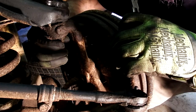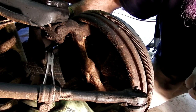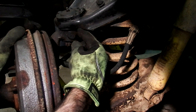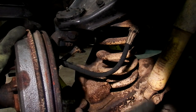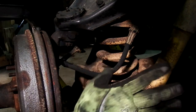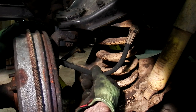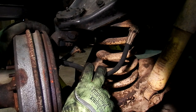So this is the top - I'm going to take off this cotter pin and get that nut off. What I like to do is just loosen this nut a little bit so you'll have a gap between the knuckle and the nut. Then you can go ahead and separate these two, and as soon as this drops down from the spring pressure, you know it's released off of the ball joint. Then you can jack the bottom and take the nut off. That way it protects you from taking this all the way off and having the whole thing fly. I'm also going to have to disconnect the shock at the bottom because that will hold the lower control arm up and not let the spring open up all the way. I also noticed that my brake line is a little worn, so always a good time to look at everything down here - I'll probably replace that while I'm in here. That's cheap insurance.